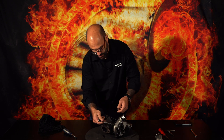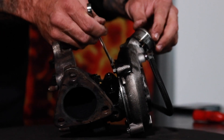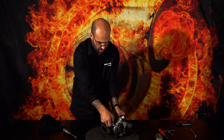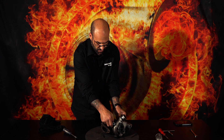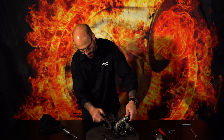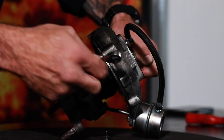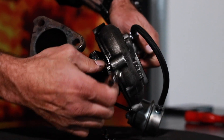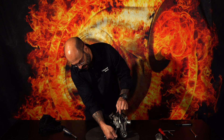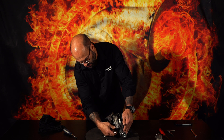I'm going to take an 8mm spanner. These bolts have just had the nip loosened. I'm going to unscrew all of these and pull the compressor housing off to reveal the compressor wheel underneath and the back plate. Then I'll show you what it looks like inside and go through the actual rotating assembly, the bearing system, and all the individual components so we can understand exactly what happened to this turbocharger.